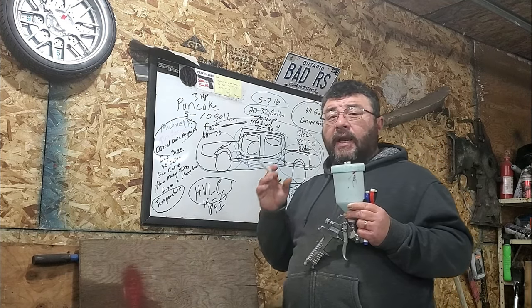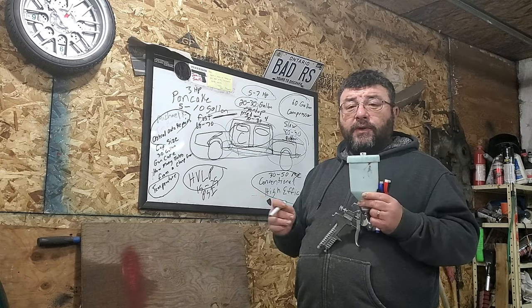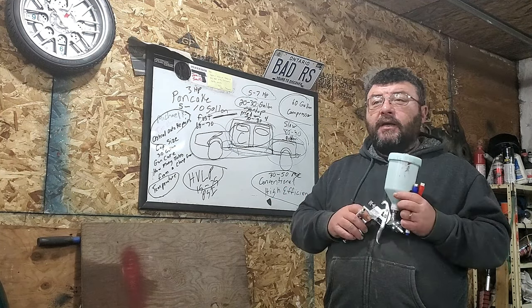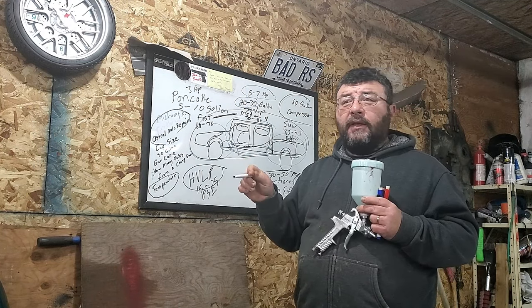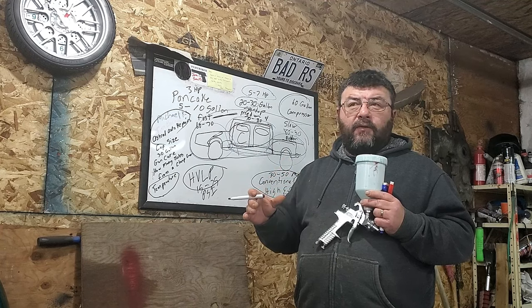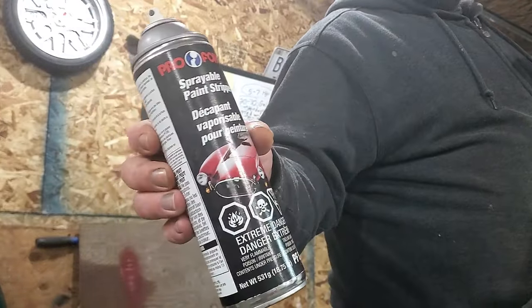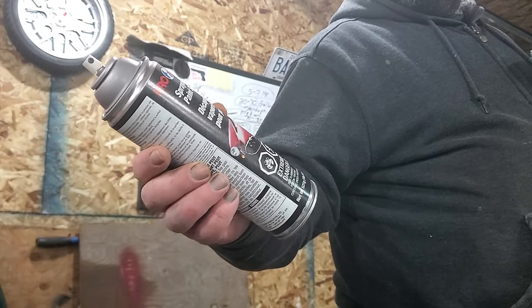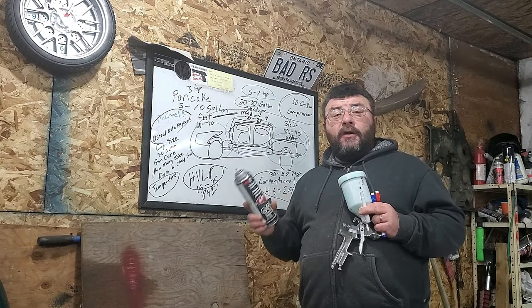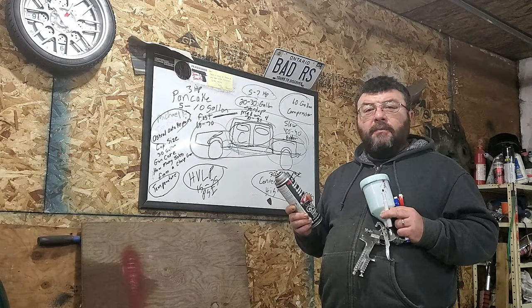As far as gun care, you want to use as strong a thinner as possible — a gun wash is even better. Clean out your guns and take them apart. Most guns come with a brush kit so you can clean them up. Another trick I like to use if you get some buildup inside: take paint stripper — I have a video on that and I'll post a link. Paint stripper will absolutely save a gun that has hardened paint residue on it. Every once in a while I'll take a spray bomb like this one, take my gun completely apart, spray all the parts and pieces, then use water to neutralize everything because you can get a chemical burn on your skin. Soak everything in it and it will bring your gun back to like-new condition.